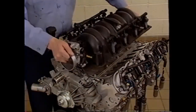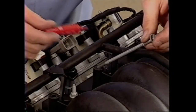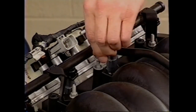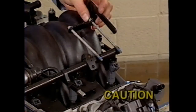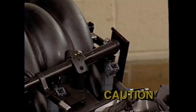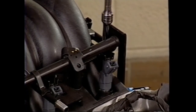At the intake manifold, be sure to use new gasket O-rings. The intake manifold bolts receive a new 5mm band of thread lock per service information specification. Be sure to position the fuel rail stop bracket onto the manifold. This bracket is a critical protection component for the fuel system. Tighten the manifold bolts in the specified sequence to specification.